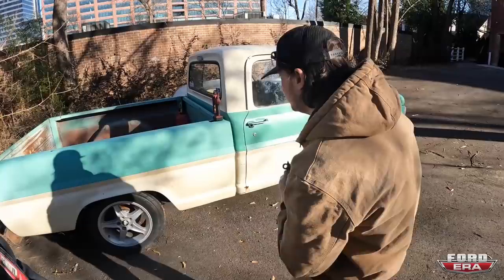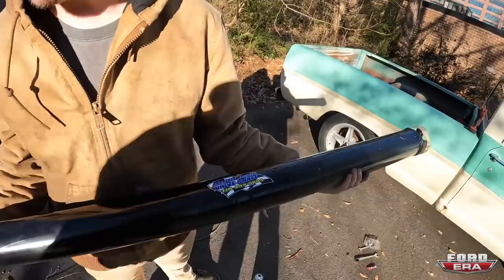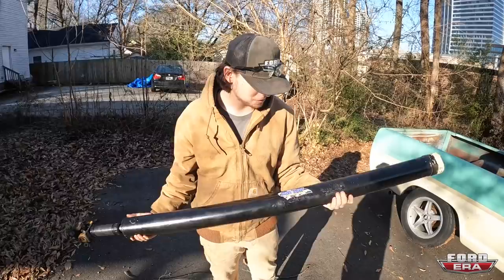We're going to slide it on in and show you guys putting it in, and maybe some more fun stuff. I'm probably not doing any burnouts until I get some traction bars in the back. What I think happened was the rear end tilted a little bit, which messed up the pinion angle and then twisted it right in. This one is a little bit thicker than what we had and for the length, it was just a little short.